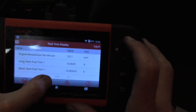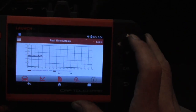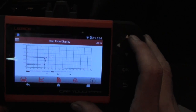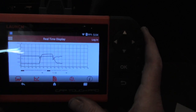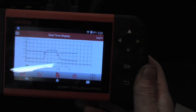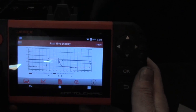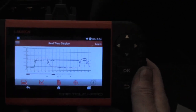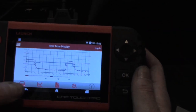So I'd like to go ahead and graph those, and it is going to be easier if I combine those. I've got my engine speed against fuel trim. You can see the auto adjust is very intelligent. And I don't like that at all. So this is not a vacuum leak — indeed. But I will tell you, it doesn't feel like an engine mount either. That is definitely engine related, and right now the engine is really kind of struggling. But we can see that there is definitely not a vacuum leak there.